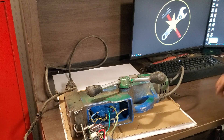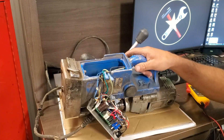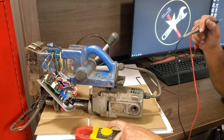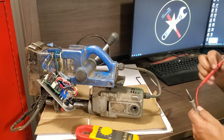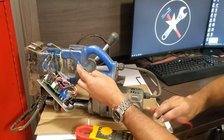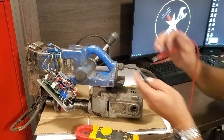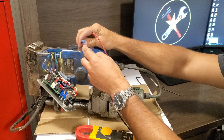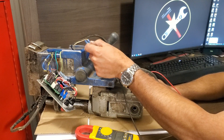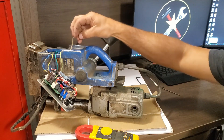To check this cord, I unplugged the connectors for the white and black wires coming from the circuit board and leading up through the handle to the top of the drill. With my multimeter set to resistance, I look for continuity between the terminal and the brush holders. We can tell from the beeping sound that the black wire tests good, but the white wire does not. This means there's a break in the wire somewhere and we're going to have to replace this section of the power cord.